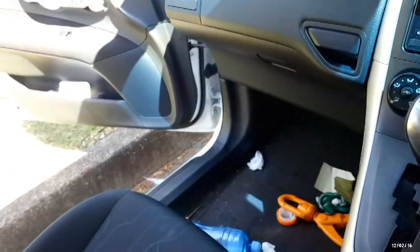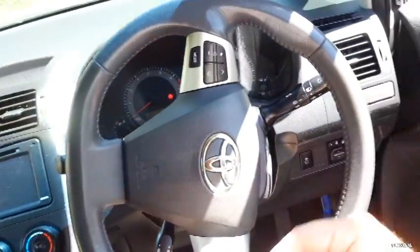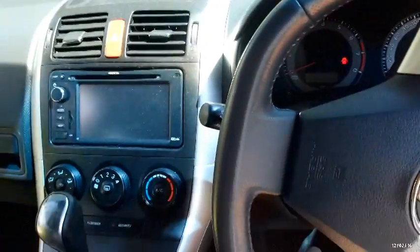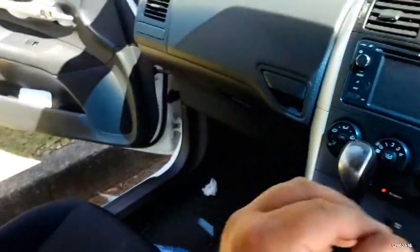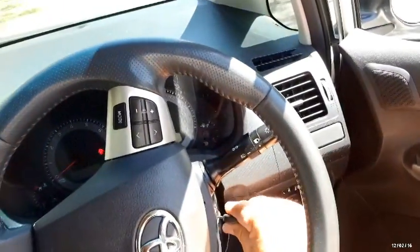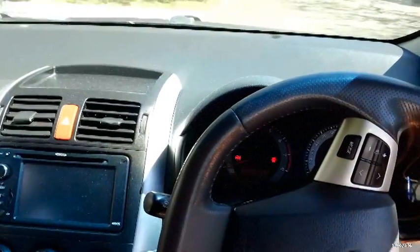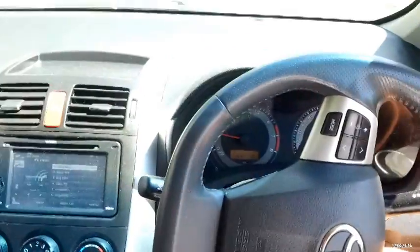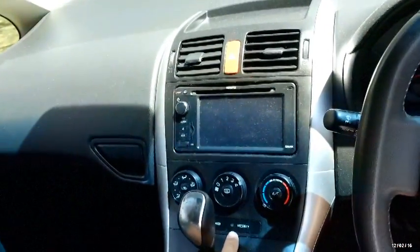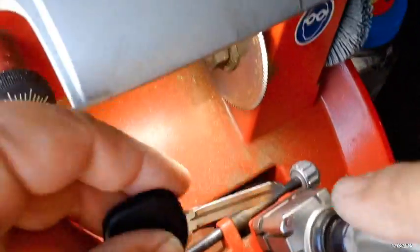Okay, we don't need to turn that on. That chip's done. And now this chip as well. This will be our sub key. Okay, so that key now should be done as well. Now we're going to force it out of learn mode. 1, 2, 3, 4, 5. Okay, so we've enrolled all the keys, the light. Okay, so just duplicating another key shell now.